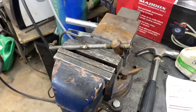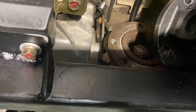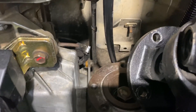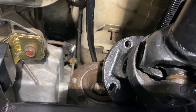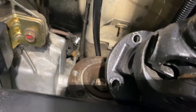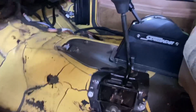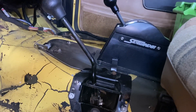All right, one rod shortened three inches. All right, I'm going to go ahead and lube up both of these ends where they snap into the bushings, and let's go try it. All right, there is the linkage — everything is hooked up on both ends. Everything fits really good, everything is clear of everything. So let's go up and check the shifter operation, make sure it does what it's supposed to. And then if it does, I'll throw this front driveshaft back in and that is a wrap. Okay, here we go inside the truck. We are in two-high, four-high, neutral, four-low. Bam — Chevy Silverado TK shifter, done.